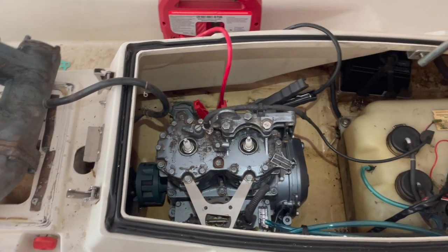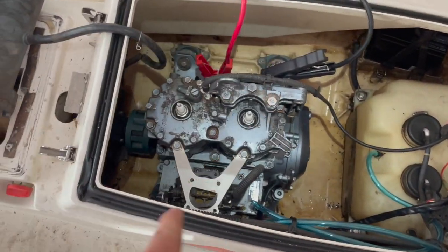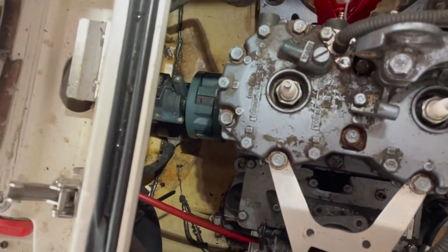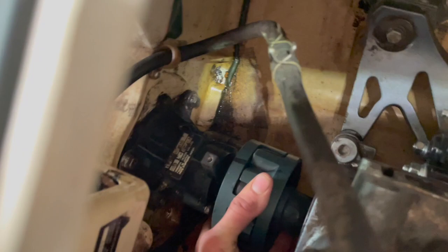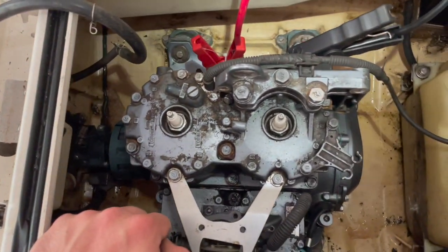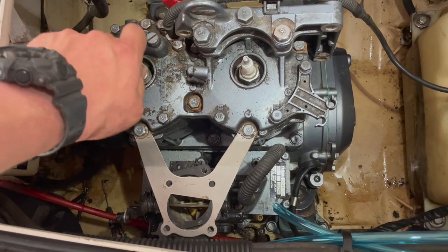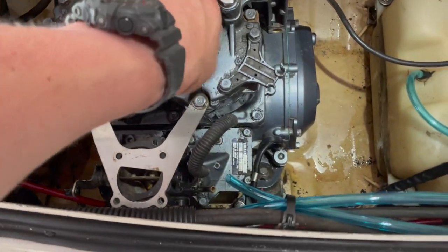It's cool. All right, went ahead and tossed the engine in. I went and put the shims back in all 4 spots. I marked the engine there. Anyways, you can't see it, but there's a tick mark right down where my thumb is, and that's an alignment for these two, so I know I took it out the same way, and it seems to be pretty happy in there. Tons of compression. Let's go ahead and pull these plugs out. You guys can see how smooth it spins that drive shaft.